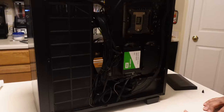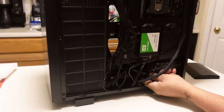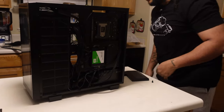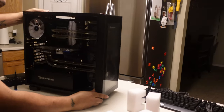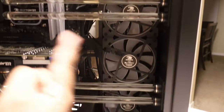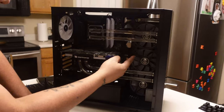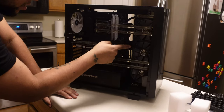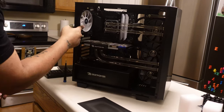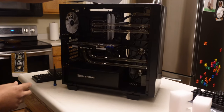The power supply — I'm pretty sure this isn't a fully modular power supply, probably around 700 watts or so. I'm going to be replacing it with an 850 watt. I'm also going to be taking out these four iBUYPOWER fans and replacing them with Thermaltake fans. Instead of intake on the front I'm going to have them exhaust out the front, put two on top for intake, and another exhaust — so six Thermaltake fans total. And I'll be changing out the power supply.